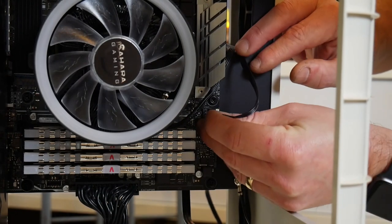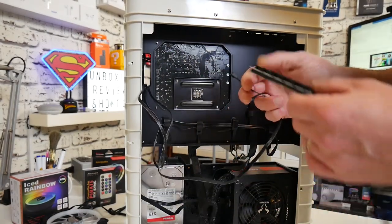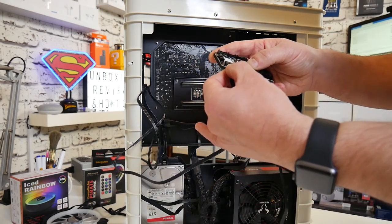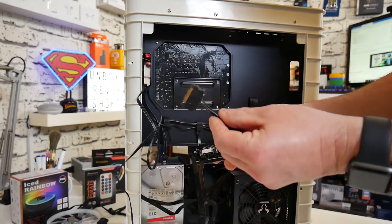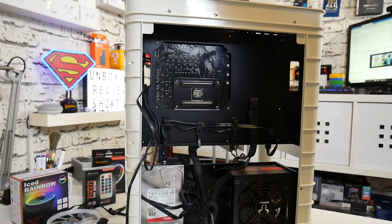We'll put the fan header into the CPU header. Moving around to the back, all we need to do is connect up this RGB connector and plug that into the RGB controller — that just snaps into place. Then we put some SATA power into this connector, and that is pretty much it. So actually connecting the CPU cooler wasn't actually that easy. I thought with the spring clip connectors they would be super simple, and with the older AMD chips where you had the exposed spring clamps with the lever it was a little bit easier. With this one it can be a little bit tricky. And because we used a thermal pad rather than paste, the thermal pad did have a tendency to move around a little bit — but I've reseated it and it's absolutely fine, making good contact.